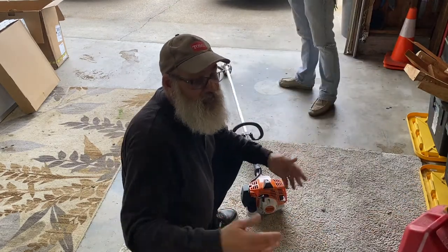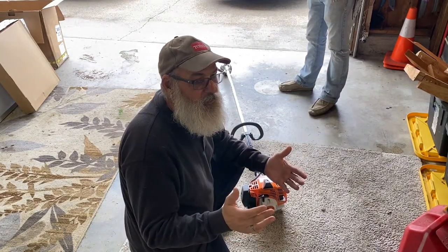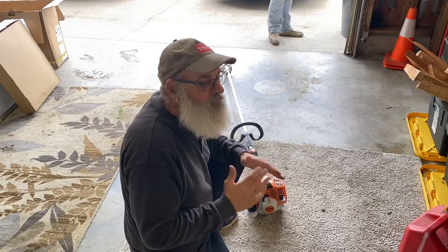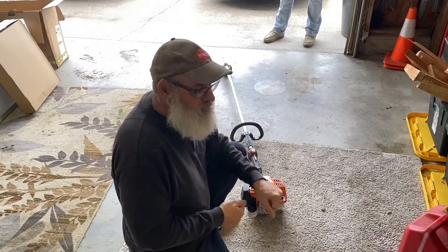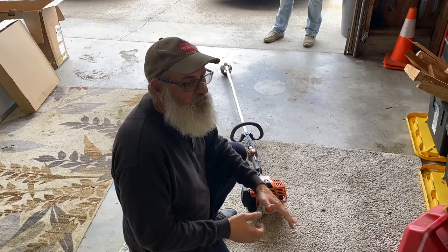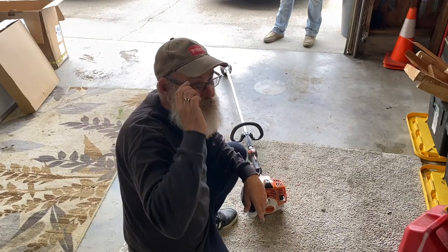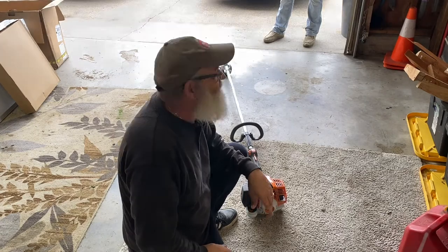So guys, that's how I set up a weeder. Ask anybody that's been doing it long enough, that's a trimmer guy, and they'll tell you, move that handle back. It just saves you so much work. You're not having to move your body so much. And it's just easier. And you're not bending over because the handle's so close. So just keep that in mind when you're doing your weeder. I know right now everybody's grabbing their wrenches and going out to move their handles.